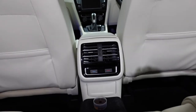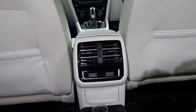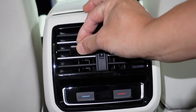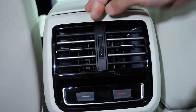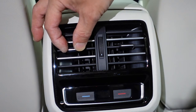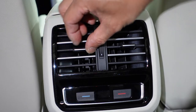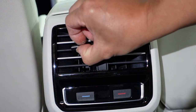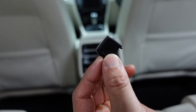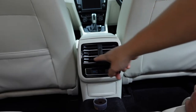What we're going to be doing today is replacing these air vents. The reason for that is because I was checking these vents out the other day - the up and down moves fine, but if you look inside when you slide this lever left and right you can't see the vanes moving like you do on the other side. This clip here at the back has actually broken off.